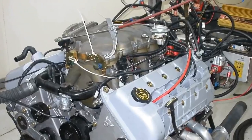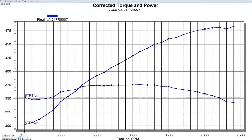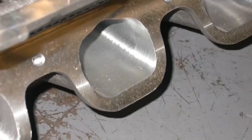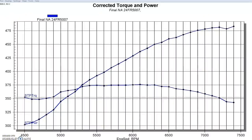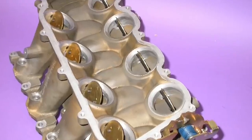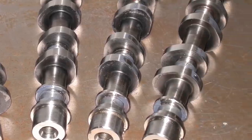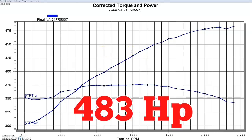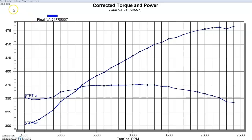This is the power output of our 4.6 liter 4-valve modular Ford — the Shawn Hyland 10-to-1 crate motor supplied with our ported FR500 cylinder heads, matching FR500 intake, and those comp 262 cams. You'll notice this thing wants to rev past 7,000 out to 7,500, and a 4-valve mod motor will obviously rev a lot higher than that. Our problem was we just didn't put enough valve spring in it, because the cylinder heads definitely had more to give, and this intake did too.